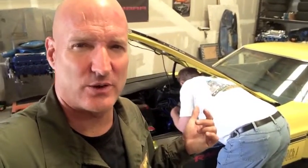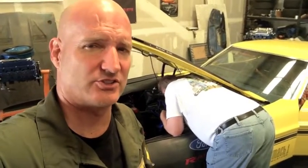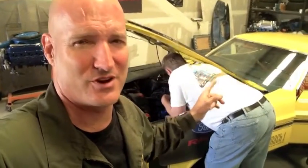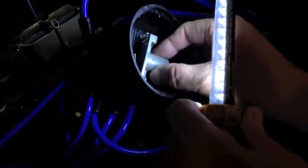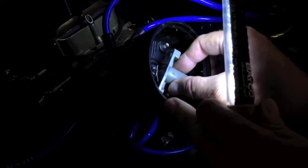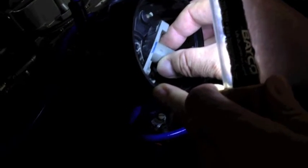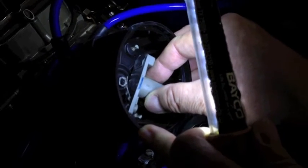Matt, we got your fender guards on there. We're diving in. So far, everything's checking out with the firing order, as I suspected. And we're going to change out the cap and the rotor, then get her started and see if she pops and crackles. Gary's putting the rear view mirror on right now. What Mr. Mike is doing right now is he's comparing the distance between the old rotor and the old cap, seeing how much distance we have with our connection.